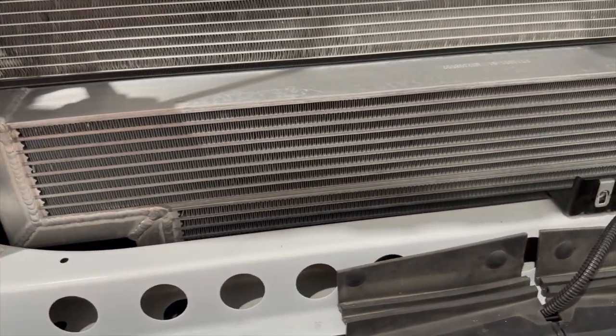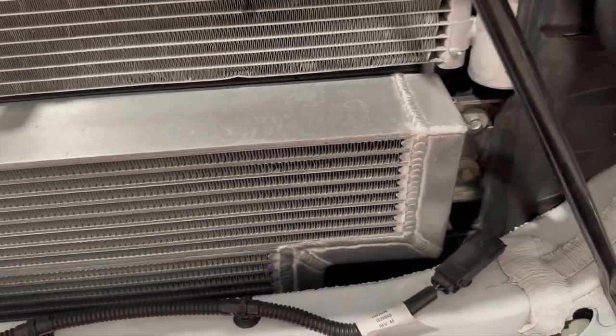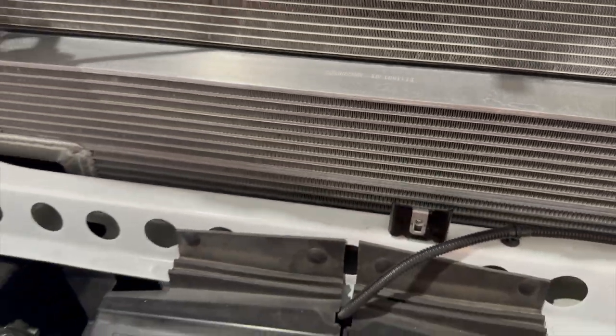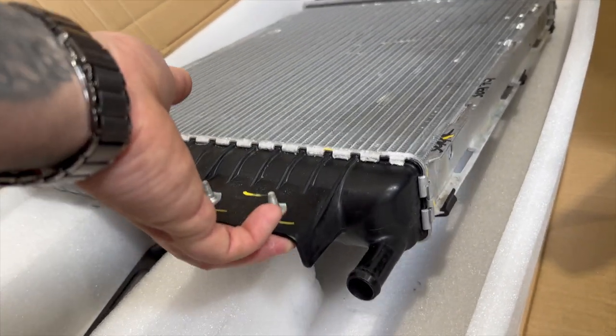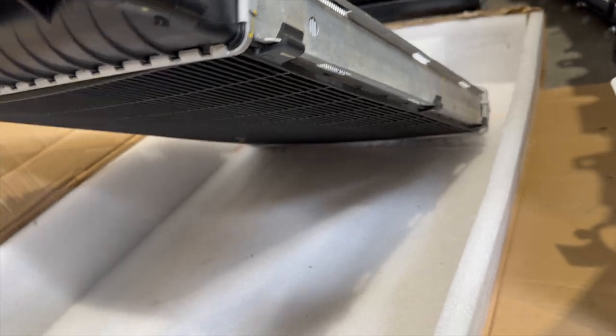Two, they're verifying the amount of airflow through the whole core design. They need all the airflow to flow through the radiator core for the charge air cooler, but also through the condenser, through the trans cooler, through the engine radiator — so there's a lot that needs to go in there.